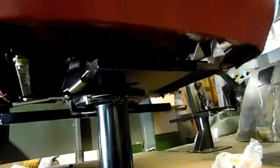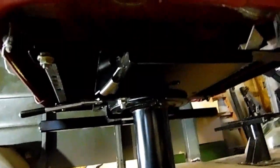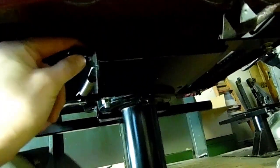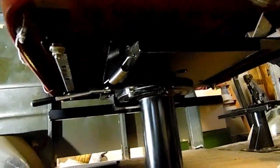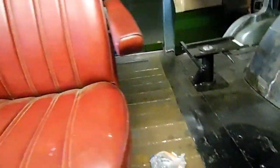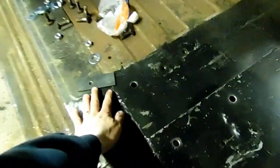Here's the seat sitting on the swivel base. I talk about them being offset — this one didn't really need very much offset on it per se. The holes still line up how we had it marked and then our hardware goes through here — nut, bolt, and washer all four corners — so this makes it a little bit different from the driver's side in that it swivels pretty good, but we had to compromise on where to fit it in this location.